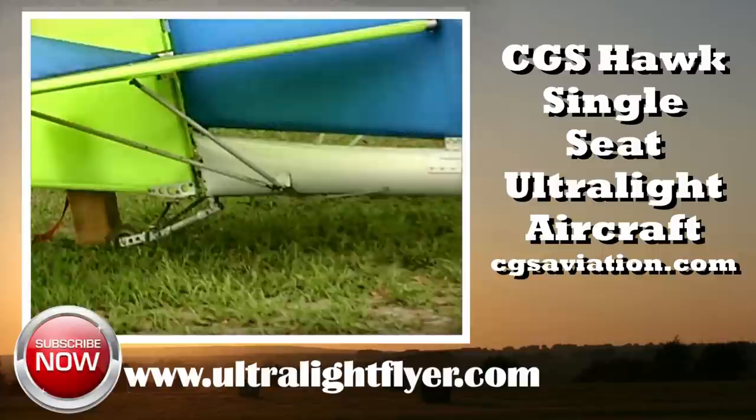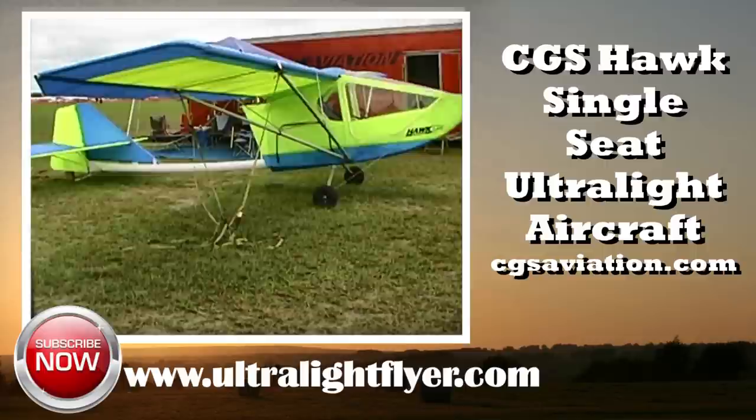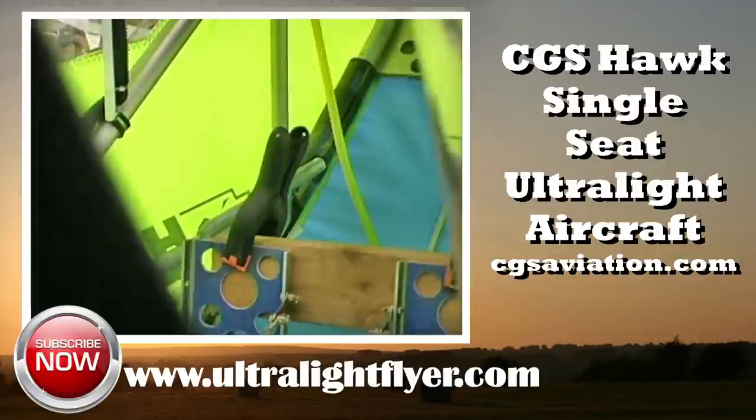The Hawk kit, which is now available in both a tri-cycle gear and taildragger, uses bolt and rivet together aluminum tube construction and is built around a uniquely curved main boom tube. The original kits took between 350 and 400 hours to build. It can be built in as little as a single car garage, using common hand tools. A small air compressor and rivet gun are suggested.